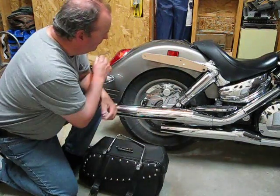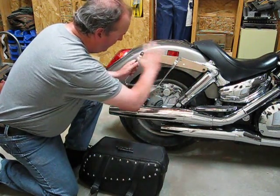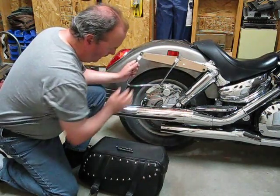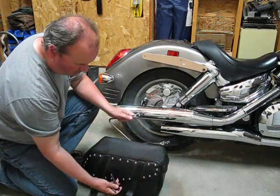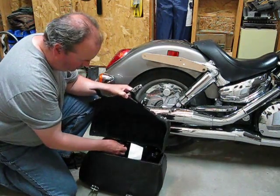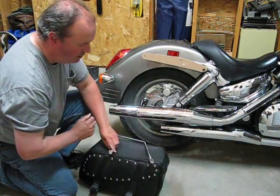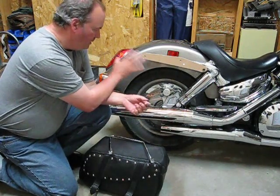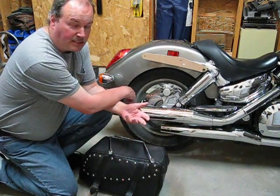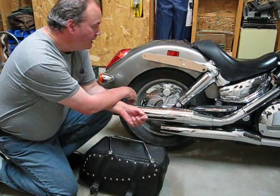You can see this is where the bracket is going to go — it fits right here. The saddlebag will go from here, and you'll see this part of the bike eventually with the bag filling this area. Two other bolts will go through a couple of holes inside the luggage rack, the bracket goes in behind, and the whole thing gets clipped right here. That's ultimately what it will be. I'm going to make two of them — one for each side. I'll make it out of either mild steel painted black, or stainless steel so that if it does get scratched it won't rust.